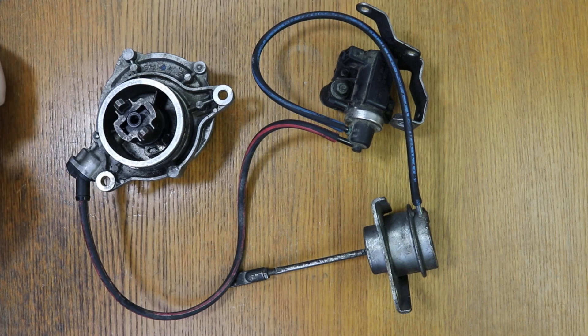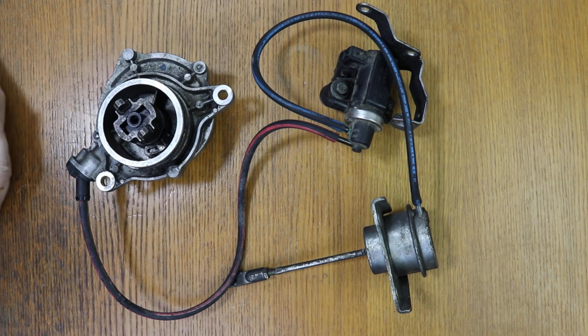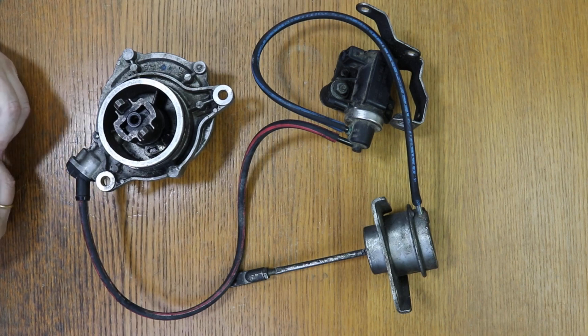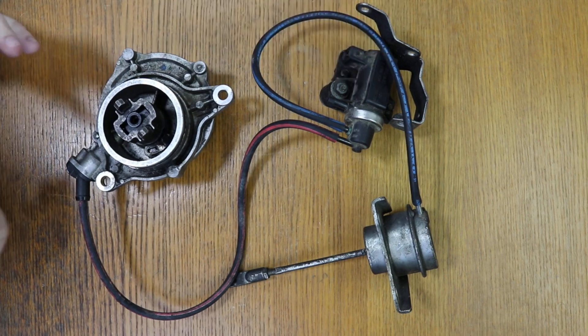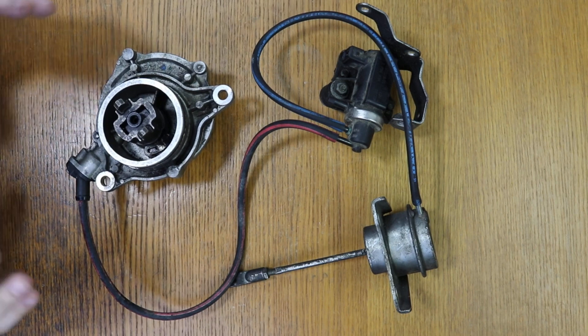A person who has problems with the turbo of his car's engine has a car with a turbo diesel engine, and when it is cold, the engine works perfectly, but when it warms up, the turbo is deactivated and the engine loses a lot of power. He has taken it to the workshop, and they have told him that the solenoid valve of the turbo is the issue, and asked to see if a bridge can be made, avoiding the turbo solenoid valve.